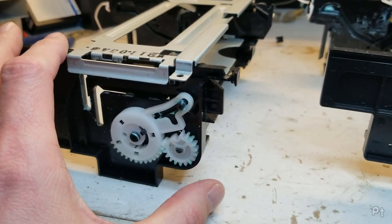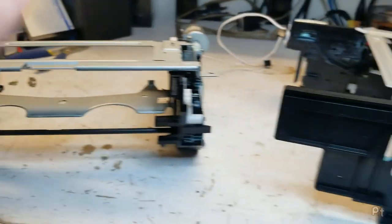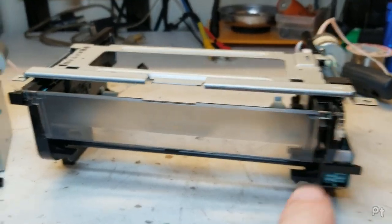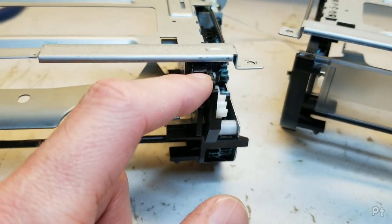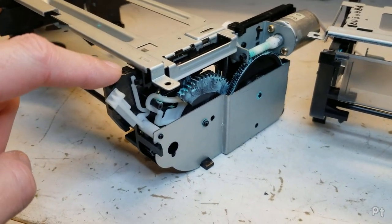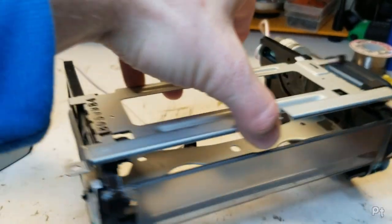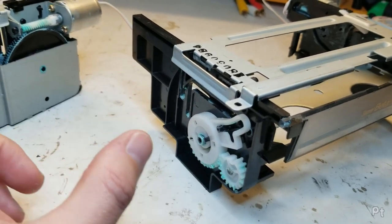I would have done it if the VCR were worth repairing, but it sounds like the 360 is kind of borked anyway. So what I'm going to do is take this side off of this one and move it to here. On this one the front flap is good, but the front flap is broken on the other one so it doesn't get held in place very well. So I'll take the motor that I repaired, put it on here, and then take this whole assembly on this side from that one and put it on here.